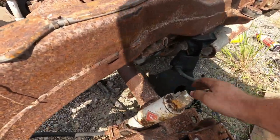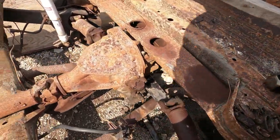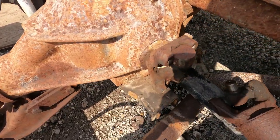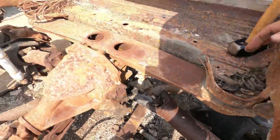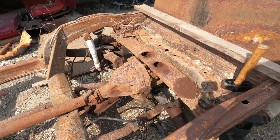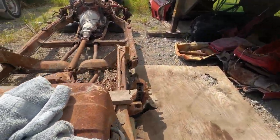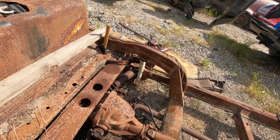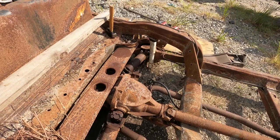There's your trailing arm loose from the assembly. I'm still going to have to cut that last bolt off-camera. But you can see there are our points of contact — one, two, three, four, five, and six — and then the spring bolt makes seven, eight with the camber rod, and it's out. That's going to wrap this one up today. Next time I'm going to show you how to get this center section out of here — the third member — and we'll do that in another video. Time for a water break — I'll catch up with you guys later, thanks for watching.